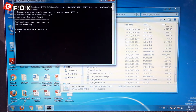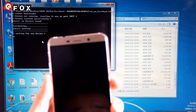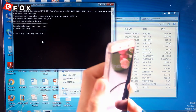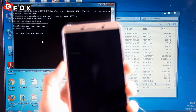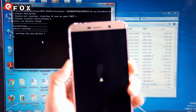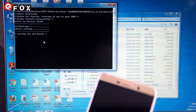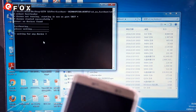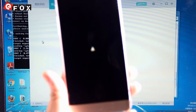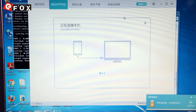As you can see, it is now waiting for any device. This is the signal to prepare the smartphone. To do that, we need to press the volume rocker and the power button together, as I show you. Then this symbol will appear and you need to connect it with the USB cable.